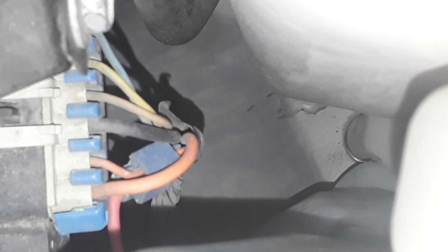I thought there might be a feedback problem, because I did not disconnect the high-speed feed wire coming off of that resistor module underneath the dashboard. But there isn't — it's not a problem. It doesn't care. It's going to try and send 12 volts at higher amperage, as well as this wire doing so at the same time. When it goes into the lower speeds, the 12 volts coming into the high-speed line from my add-on does not back-feed the system and cause any problem.